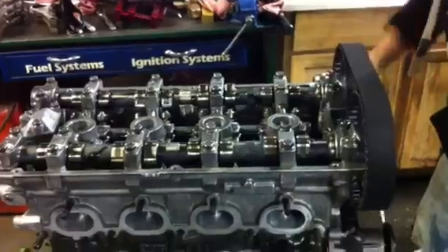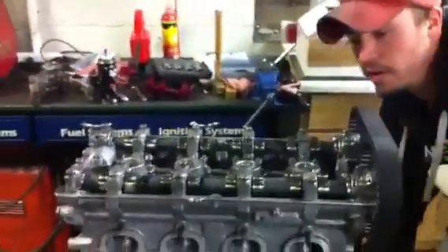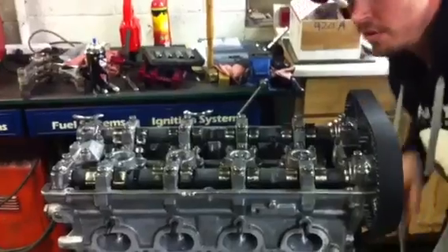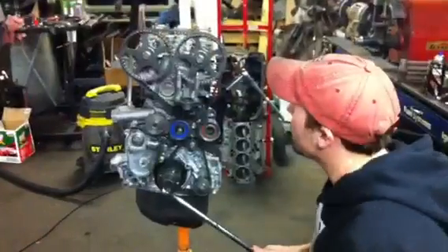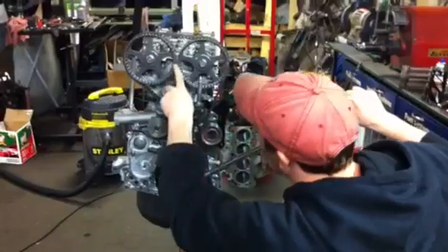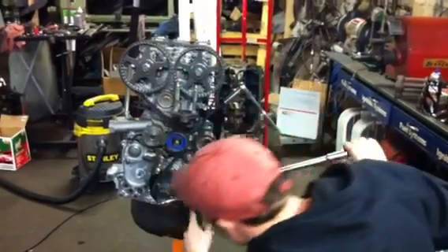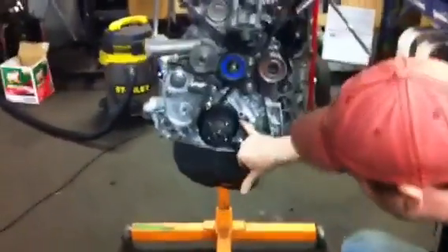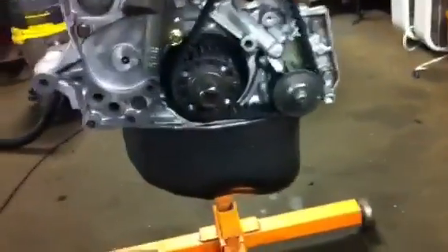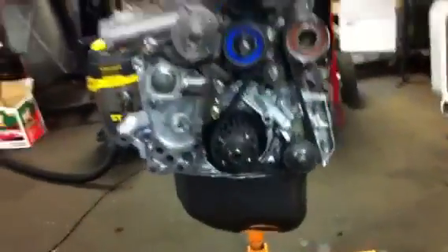This has got 272 cams, so it's going to be a little bit harder than a regular OE build. But other than that, to make sure everything's right after you've spun it, you're going to watch your two cams coming perfectly together and then check your crank — we're spot on right here. After turning this thing over about 15 to 20 times, I feel confident that this engine's not going to have any problems.